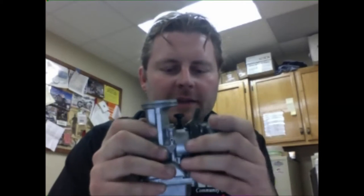Wrapping up: the video explained things well, but I can't stress enough that it's the mechanic's job and integrity to make sure the carburetor is fully seated — just like with everything else we install. My summary advice: about the only way to make that happen is with good lighting. You've got to have a flashlight so you can see what you're doing. Think 360 degrees — if you're installing a carburetor from the left side of the motorcycle, walk around and check the right side, the top, the bottom. Look at everything — same goes for the airbox. Good light, use your eyes, stop and think, and check your work.